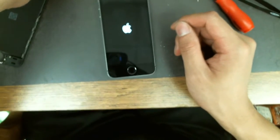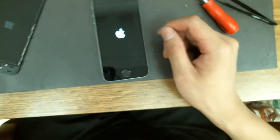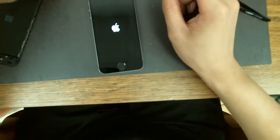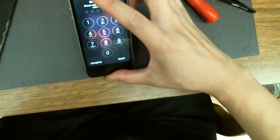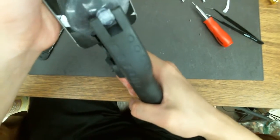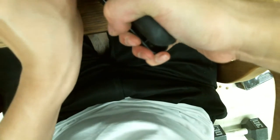This is a horrible instruction — I forgot to put this thing in. I was wondering what this was, why it was sticking out. This is a good video for those of you who don't do this very often. I don't know how I forgot that — it looks like a microphone. Or a speaker — this is a speaker. Let me see if the screen has any lines. No lines — so the screen is fine. It was really just the touch ribbon cable and the FPC connector being loose. So you got to see me do it three times. Clearly I'm not good at this — I'll be getting better after all those tries.